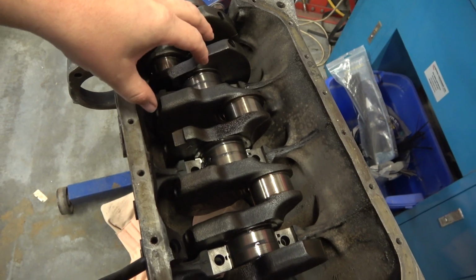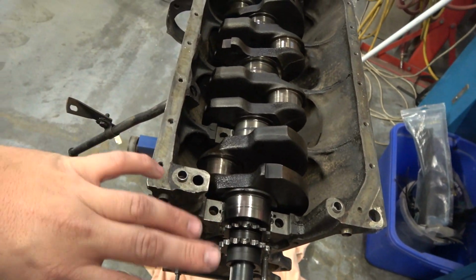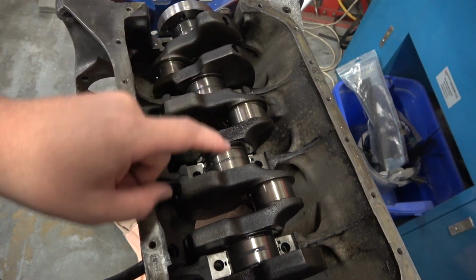All right, that's our pistons attached to our con rods. Now I'm ready to go and have a look at the block just real quick, because I've had to clean up the crank and get that ready to go in. So we've got the bearings in, now I've got the crank in, and I've put some rebuild paste on the bearings and on the crank journals.